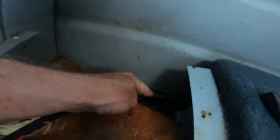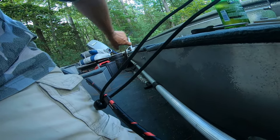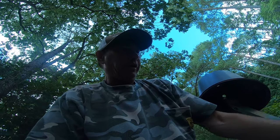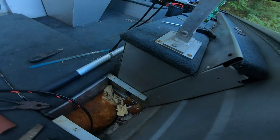All right, this is the situation: underneath, all the wires are run through and spray foam was put over, around, and under everything — it's completely covered with spray foam. So I'm going to drill a hole through my rod locker, drill a hole through the other side of the rod locker, loop it through, and be able to access my batteries. Pretty thick aluminum, so I'm going to score it first.